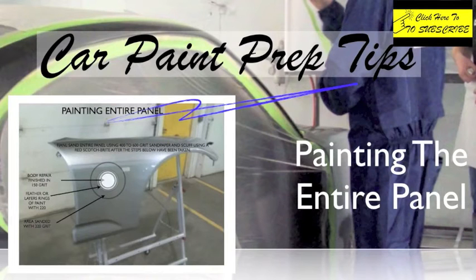And then the area that we're going to paint, anywhere we're going to paint, we're going to use, like I said, anywhere from 400 to 600. We may sand past our 220 grit area, a little bigger area with 320, where the primer is going to go. And the method I'm telling you, this is not the only method. Your instructor or supervisor may have a little different method that they use.